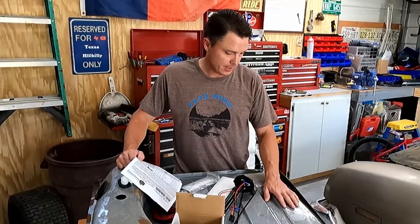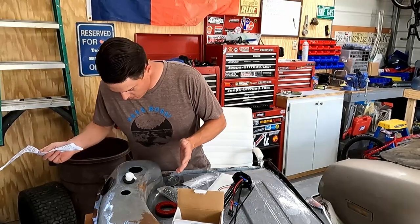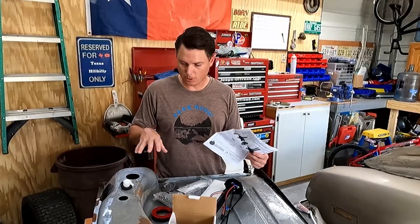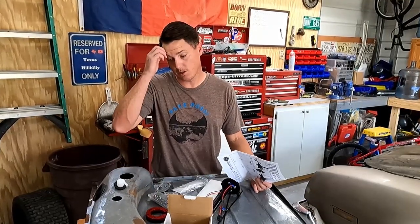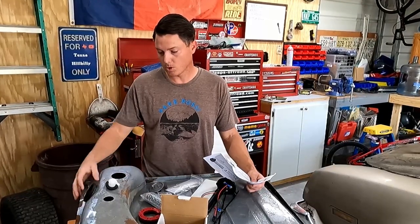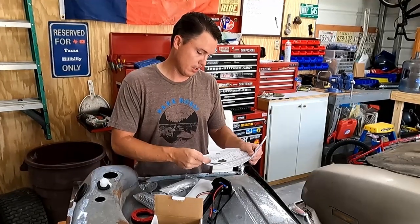It's been about five days since I did the KBS tank sealer, and it has done a fantastic job. As far as I can tell, all pinholes are sealed — it's an amazing finish. You can hardly tell this is the same tank from before. What we're at now is installing the Hyperfuel 40015 — this is an in-tank fuel pump designed to retrofit your factory fuel tank into an EFI fuel tank. You have to replace all your fuel lines and you don't use your original sending unit or your original intake tube.